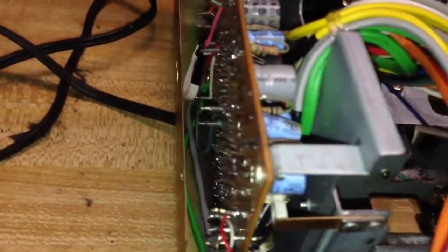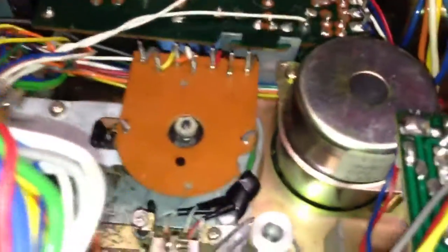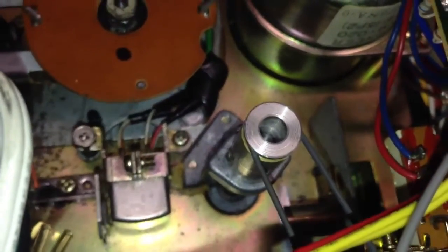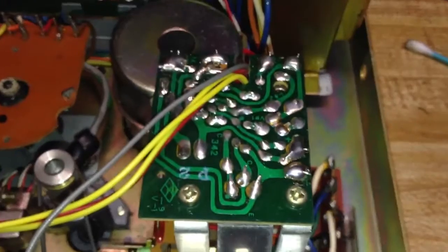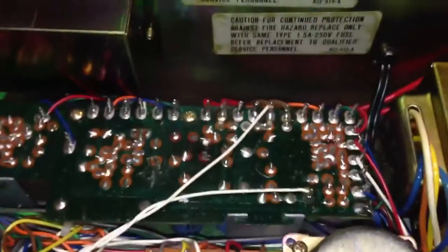Let's look inside the unit here. You'll see the back end of all those little switches we saw on the front. We have the record and playback pre-amplifier over here on this side, and we have a bunch of wires and the drive motor right there. We have the capstan right there, and hanging off the capstan is a belt that drives the time counter you see on the front. We have a little speed control module right here which controls the speed of the tape, and we have a fuse and a transformer. There's another board back here — I'm not sure what it does, but I'm sure it's very important to the playback of this unit.